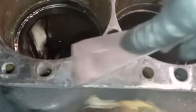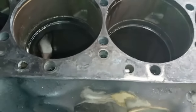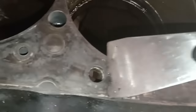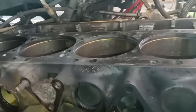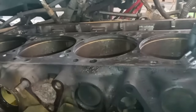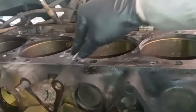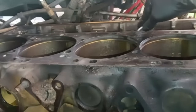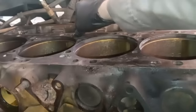I'm going to use scrapers. I usually use this sharpened steel knife-style scraper first to get the largest materials off — any excess gasket material, paint, dried oil residue, coolant residue, the gasket material itself. Get as much off as you can. Then I typically switch over to a razor blade-style scraper. These are great — they retract, when they get dull you can replace the razor blade for extremely cheap. As you can see, they get a lot of material off. I already scraped this with the knife-style scraper, and now I'm using the razor blade-style scraper.